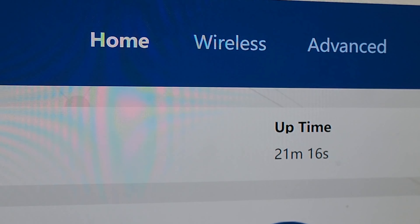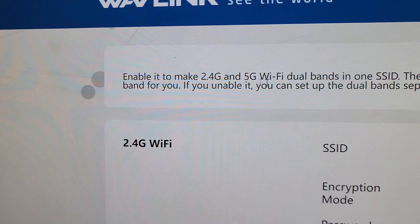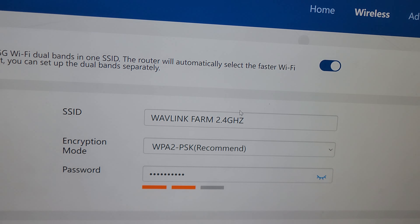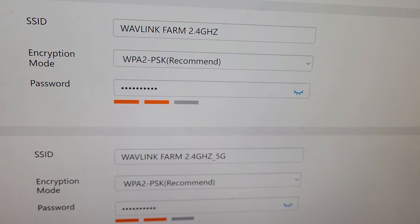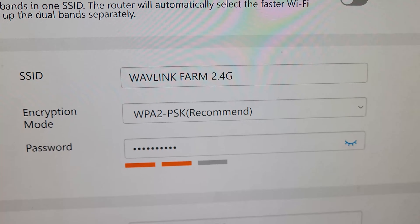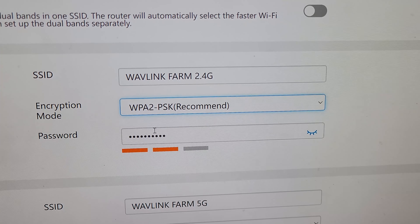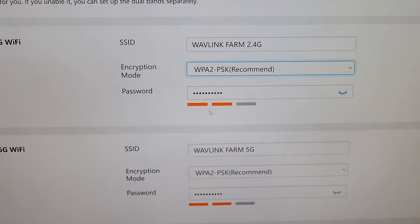Come up to wireless. In wireless you're going to have an option to enable the 2.4 and 5 gig dual band — that means the router will pick the fastest speed it's going to get. You do that by toggling this little line here, which gives you just the one Wi-Fi signal. In my case I'm going to leave that off. Really easy to rename these — you just choose your SSID, what you want it to be called. You can choose your encryption mode: open, WPA2, or WPA3. We're going for the recommended, and then you choose a strong password to connect.